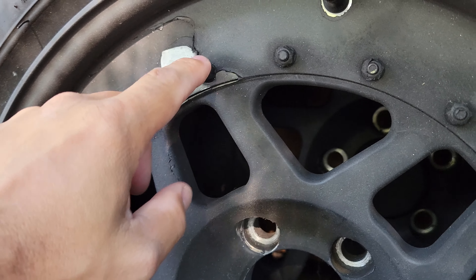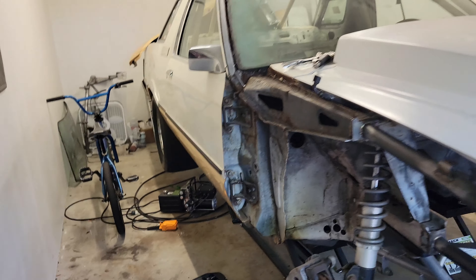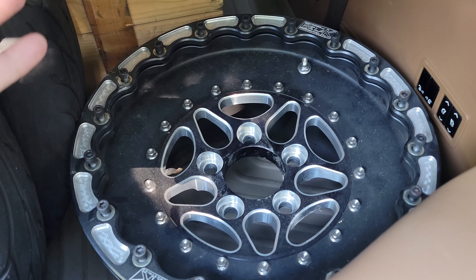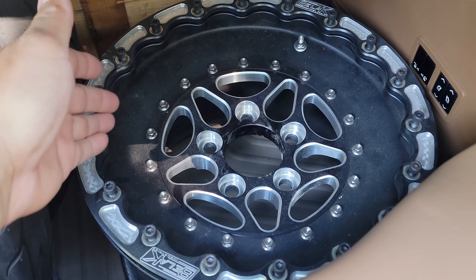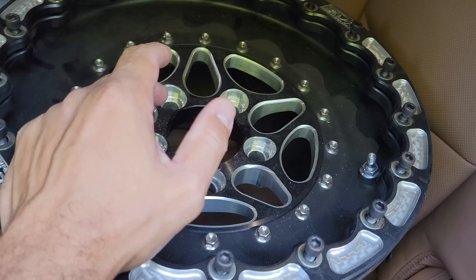So I'll probably be selling those, but I'd like to know what can fit back there. The fact that I can fit a good size tire back there makes me happy. I do have a matching set of Bogarts, but he also had some Belak S197 rears. That's the exact backspace and bolt pattern I need for the Fairmont, because it's a 94-95 differential width on a Fox body and I need a little bit more backspace. This is a seven and a half inch backspace wheel from Belak — I'll take that too because I can use it on my two S197 cars and a Fox body. Why not have a wheel that works on all three vehicles? So I went ahead and picked up the wheels.